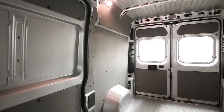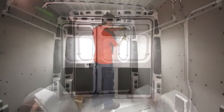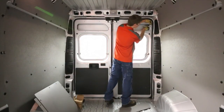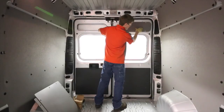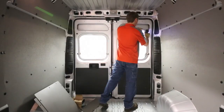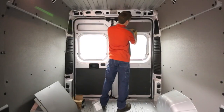Last but not least are the rear door panels. The easiest way to do this is by closing the doors and working from inside the van. For each of the two upper panels, measure seven-eighths of an inch down from the bottom of the cavity and make two marks below the cavity — one toward the left end and one toward the right end — to keep the panel level. Then measure three-eighths of an inch toward the side of the door containing the hinge and make another mark. Position the panel so that it lines up with all three marks and locate the center of each of the four slots on the sheet metal. Take the panel down, drill one-eighth inch pilot holes, and then quarter-inch finishing holes in the four locations. Reposition the panel and insert a smaller thread fastener in each of the four slot locations.